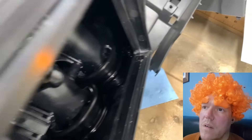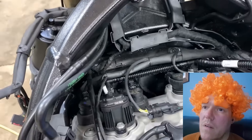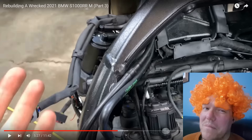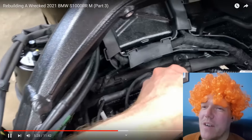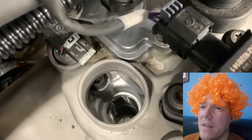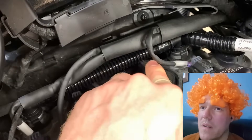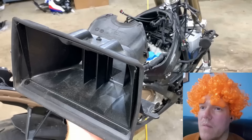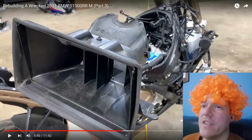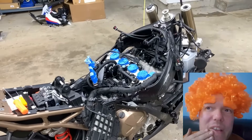I believe that is oil inside the old broken airbox, and the side where the oil is is the side the bike was leaned over on. That could mean there's possible oil in the injectors from oil rising through the engine when it was over on its side — crankcase breather. Pull one of the coil packs out just to check if there's any oily substance on the ends. The injector is way down in there — once we get the ignition figured out, if this engine is hydro locked we'll know where to start. The replacement part isn't in the mail yet, so we'll move on to something else.